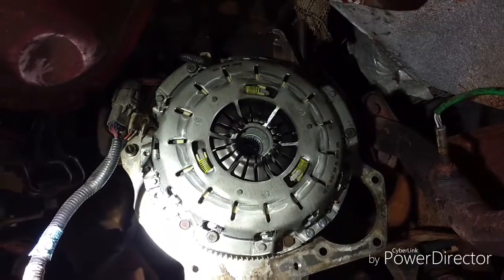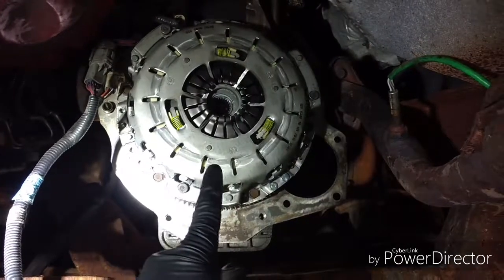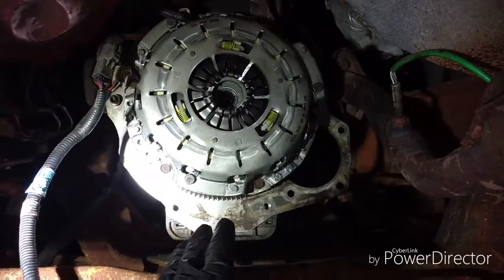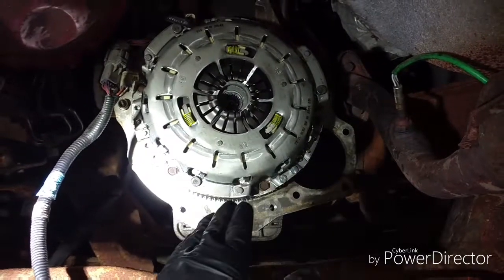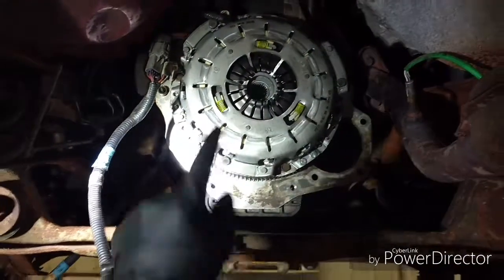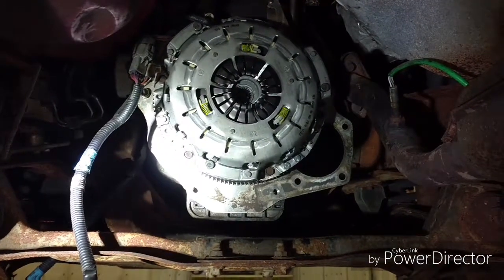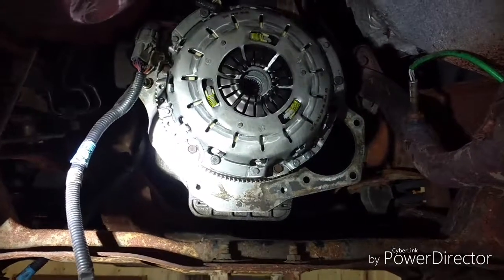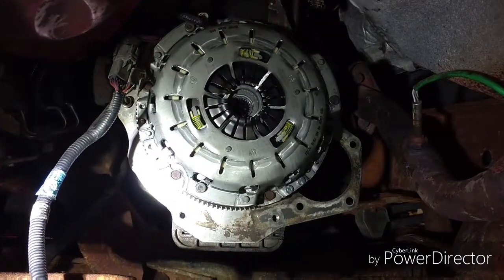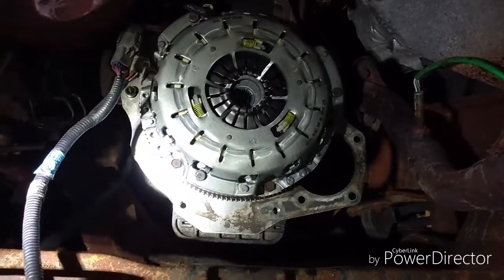While I was up there I decided to get a rear main seal. The seal behind the flywheel had a little leaking on the bottom — it really didn't bother me — but I started thinking I'm already here, I might as well change it. That rear main seal was fine, probably could go another 50 to 60K before I'd have to rip it back off, but who wants to pull a transmission off for an $18 seal? So I spent the 18 bucks.